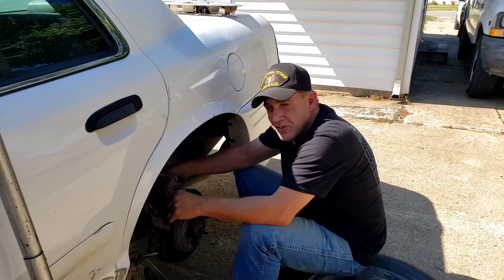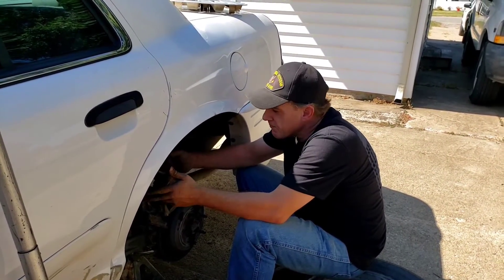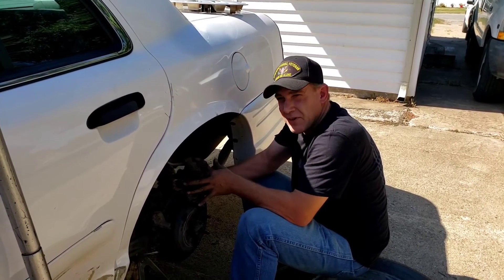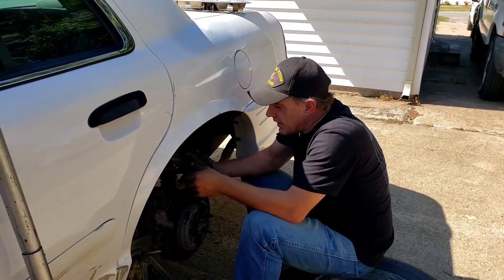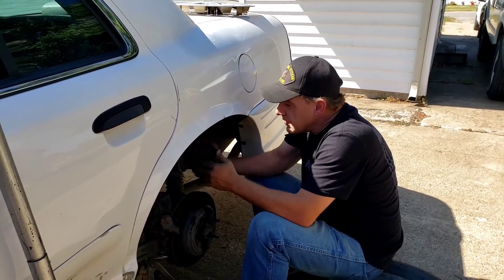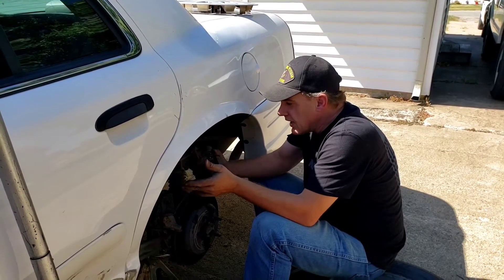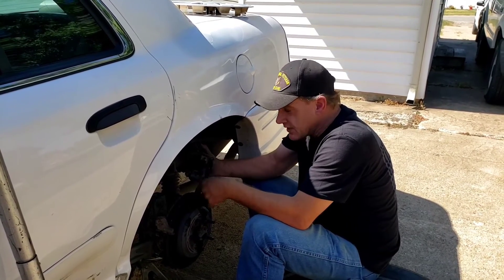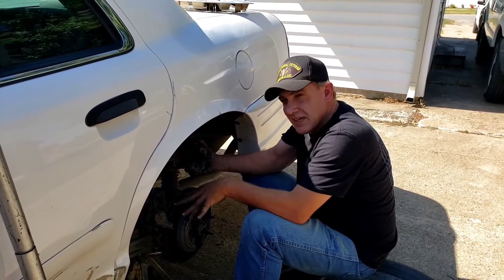We had to do something that's sometimes pretty typical: the brake cylinder had a lot of pressure on the piston, so we had to loosen up the bleeder valve in order to get it back far enough to accept the new brake pads. We pushed it back, bled it, and a bunch of fluid came out. You need to get all this cleaned up, and when you do that just remember you need to brake-bleed your brakes accordingly and make sure you've got plenty of fluid.